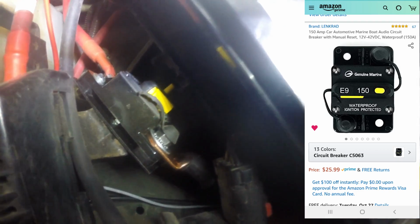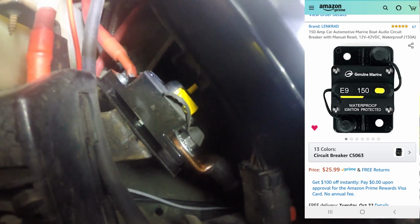I'll put a link in the description. That's a 150 amp marine grade breaker that is resettable. So right now it's off, so I can cruise around knowing that there's no power going to the winch in case I get into some deep water, not worried about it shorting anything out. It's turned off. So all I gotta do is just hit the switch, power's on, I'm ready to winch whatever's in the way out of the way.